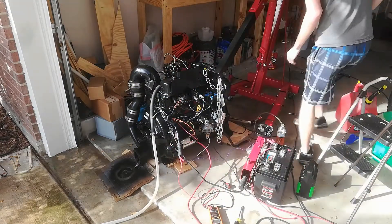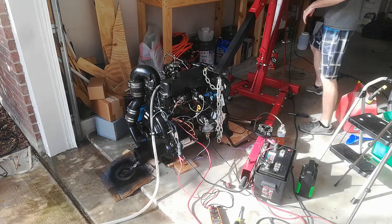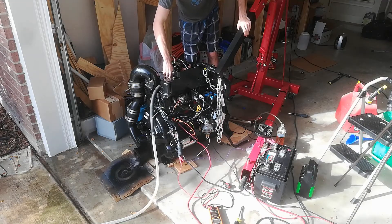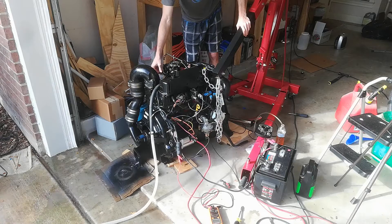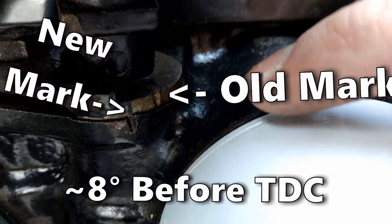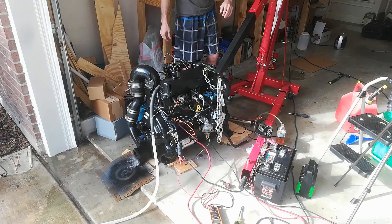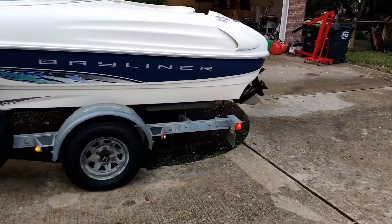After I made a small adjustment I went ahead and tried to start the engine again. I was pretty amazed to see that just making the slightest adjustment in the distributor affected the timing to where the engine just fires right up and runs great. I did end up adjusting mine probably about five times until I had it right. For my MerCruiser 3-liter engine, the sweet spot ended up being about eight degrees before top dead center, but the correct timing is going to be slightly different for each engine, so you can always double-check with the manufacturer specs on your engine.